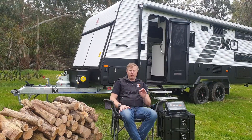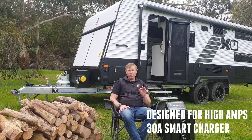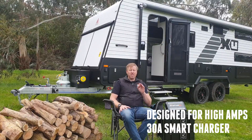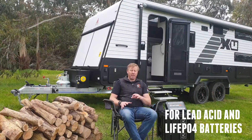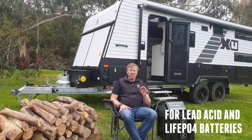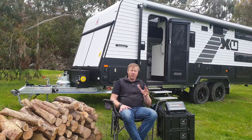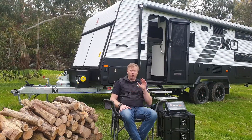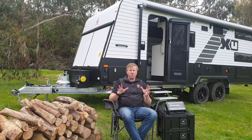The HA model is designed for high amps. The beauty of that is you've got a 30 amp battery charger. It's an intelligent charger with multi-stage charging, and it'll handle an AGM style battery, a lead acid profile battery. It'll also handle the lithium batteries — the way of the future. You can add a lithium battery at a later stage and, via either the Trek display or the Odyssey, you can update between the two different battery types as you go.